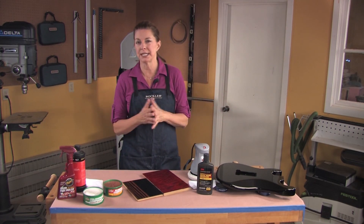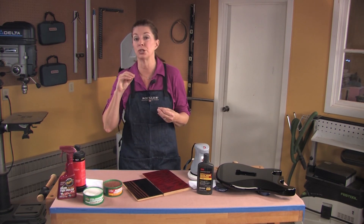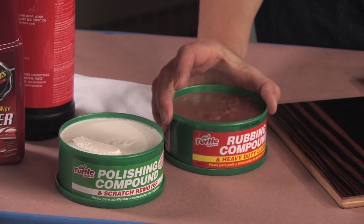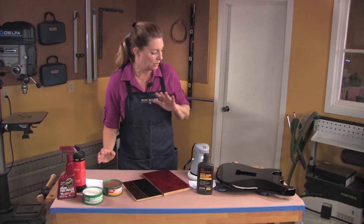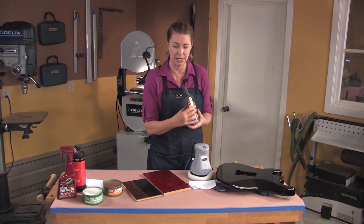The entire process begins with a sequence of sanding steps from 600 through the grits to 1200 or finer. After that, you would apply rubbing compound either by hand or by machine, and then follow up with the finer polishing compound. And once you've got the surface all nice and shiny, you can apply swirl mark remover.